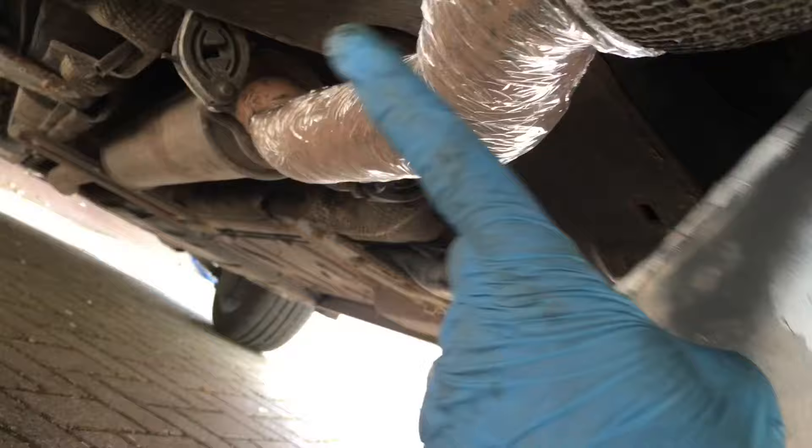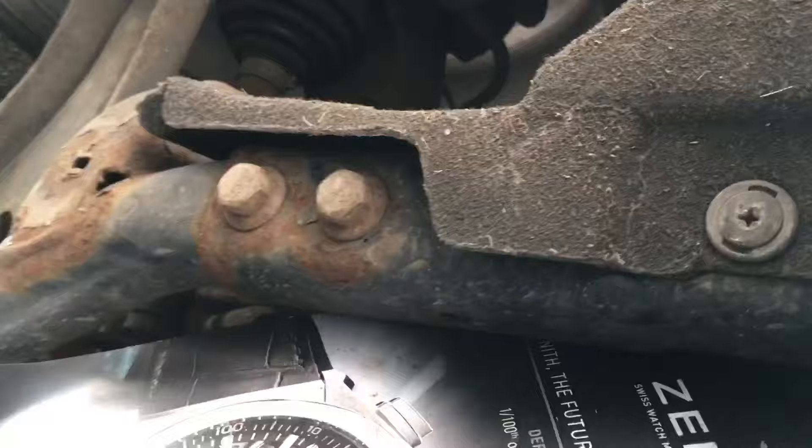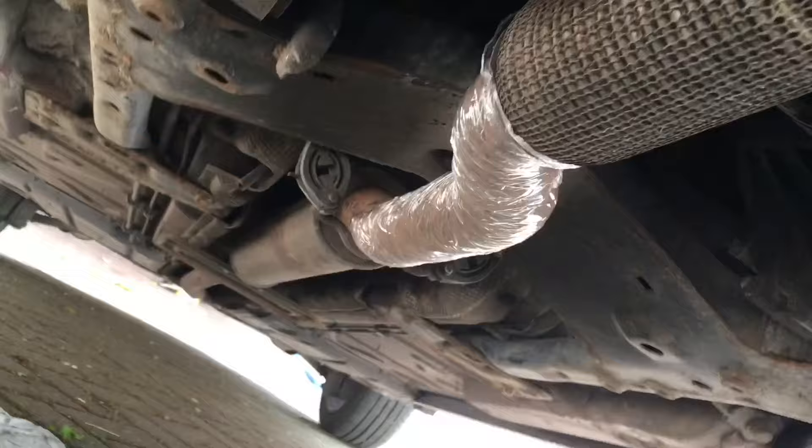You want to cover up some things like the exhaust — I've used cling film, obviously when the exhaust isn't hot, or you could use aluminium foil. When you're spraying near belts, use a bit of cardboard to shield them while you're spraying. Cover yourself in overalls, preferably a hood, definitely an eye mask and a face filter. Cover the ground with an old sheet.